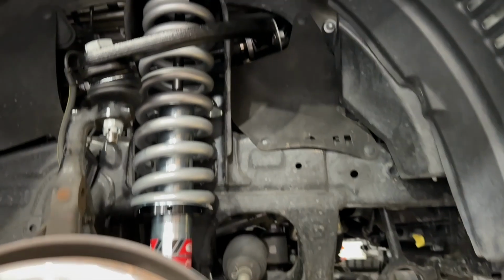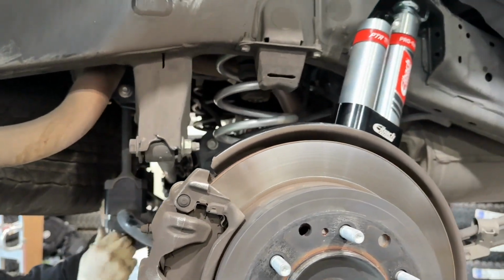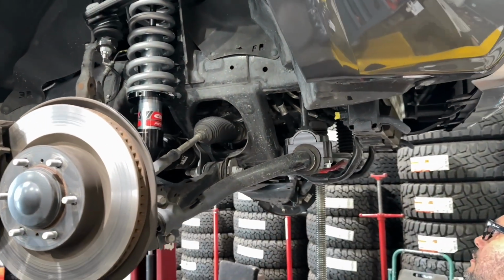After lifting the vehicle, the spacers help bring the sway bars back to their optimal position so that the KDSS system can still function properly. It helps reduce the infamous KDSS lean, and handling improves as intended.